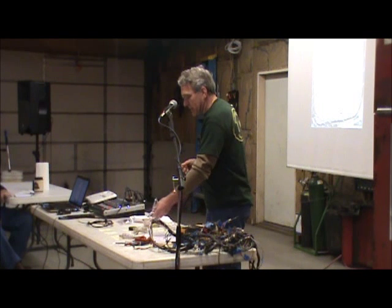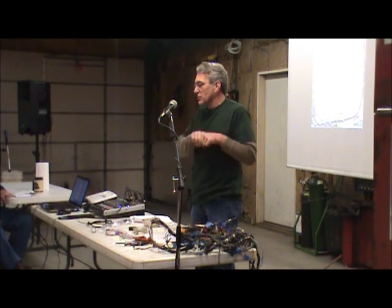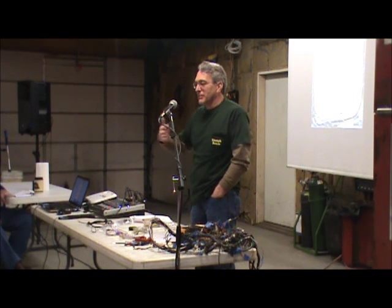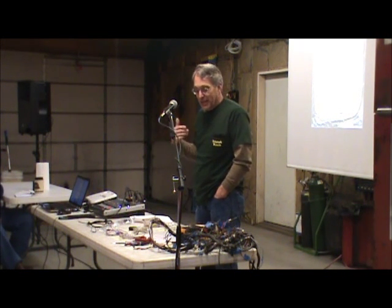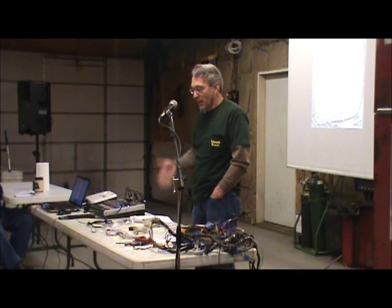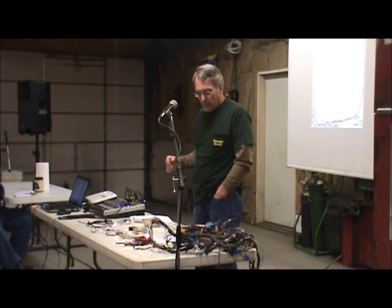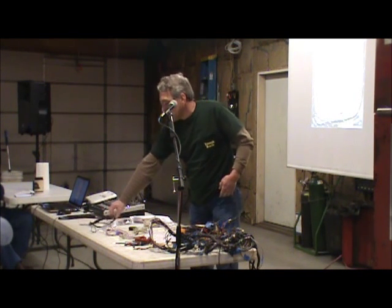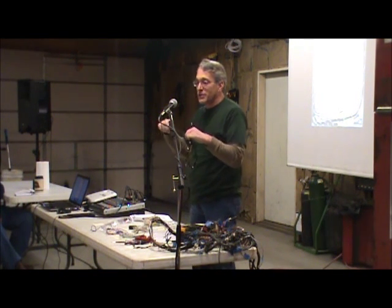One of the things I've seen, and there's not a good way around it, is I want to add auxiliary driving lights or something, and they'll just run a feed wire out along the main harness. At least you've done that much. But you've got a single conductor outside of everything else, just kind of rattling along with the car as it goes down the road. To me, you're asking for trouble because you're going to eventually abrade through that harness somewhere, and that lousy little wire is eventually going to find a ground, and then you might have an issue with that. One of the things that I like to see when you've got a single conductor is put a piece of sleeve over it. Then that way at least you have two layers of insulation which prevent that problem.